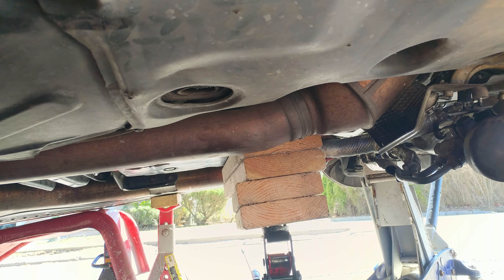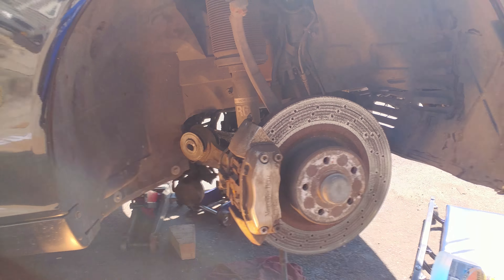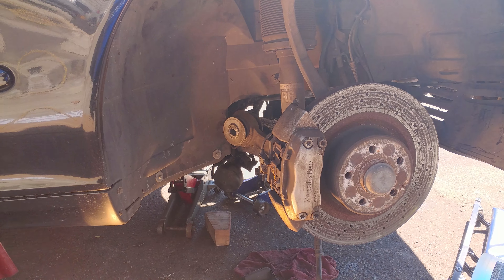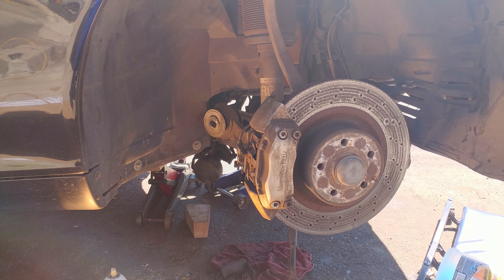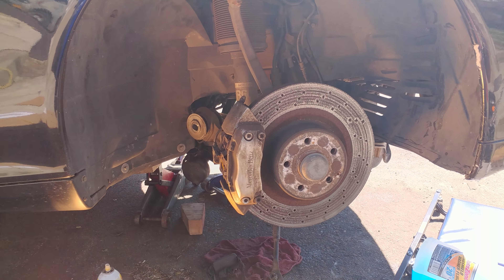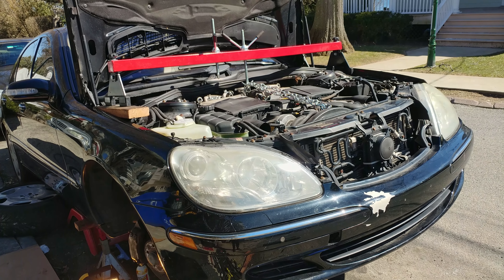Anyway, it's still a good unit — shifts nice, 85k miles on it. Interestingly, my car's transmission also failed at 85k. I took the filter off, checked it out, it seems okay, so I left it. I drove it and it shifts well, but I had to redo the adaptations on it, and I'll probably rerun them again. You need two people when you want to save adaptation values.